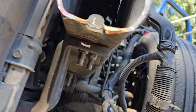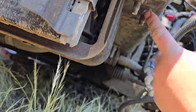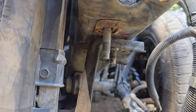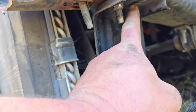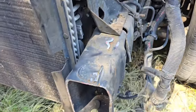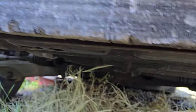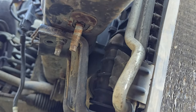These two bolts here — I'll take them out, move this bracket, and just have it held on with one bolt. Then if I really want to, I can drill another hole through the frame. That should move this back and give me enough clearance to chop this horn off. I moved the bracket back a bolt — I could probably drill another hole up through here if I want another bolt on. I had to take this bracket off and bend it out a little bit, and it worked good.